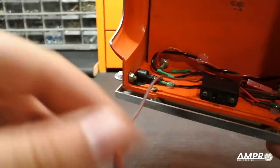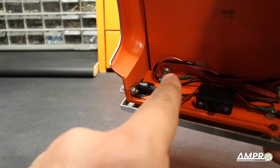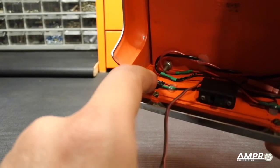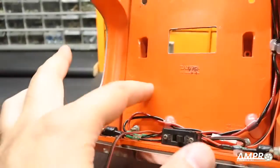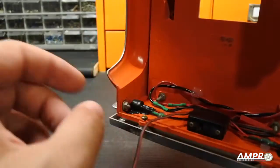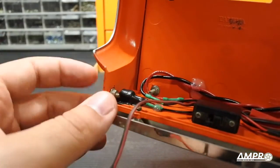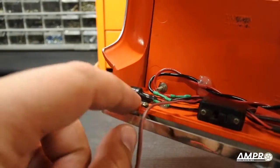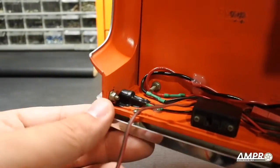As for the electronics, I went ahead and plugged in a 5mm LED — in this case a red high output LED — popped it in the side, and this red you see here is liquid electric tape. I stress to you that if your body is a lighter color — in this case orange, which is a white ABS body — when I first put this in there was a slight glow through the body, bright enough to glow through the paint and ABS on the other side. So I pulled it back off, covered it with black paint, put the LED back in, and covered it again with liquid electric tape.